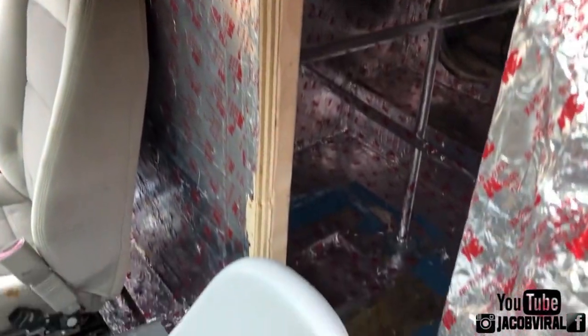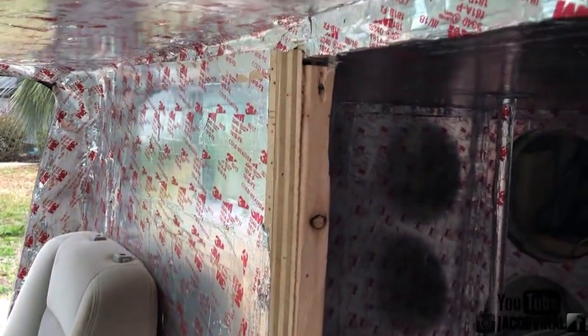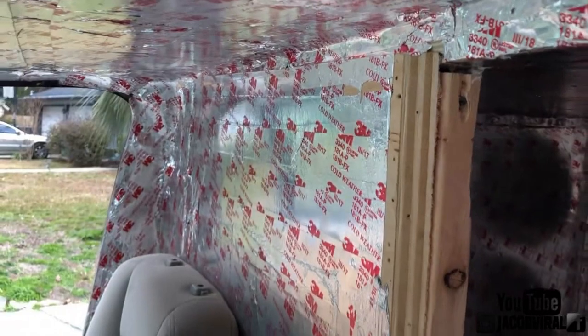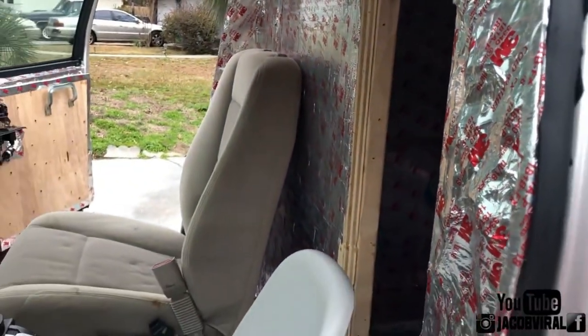All right, last thing I'll mention on my enclosure is the port. I didn't mention that. Right now it's at 14 by 43, which is 600 square inches of port. I'm going to be adding some roundovers down there. You can hardly see it, but it's going to be rounded over with PVC, hopefully. Right now it looks trashy and it's not even 100% braced properly and screwed in enough yet, but I'll make it look better by the time I'm done for the next video.